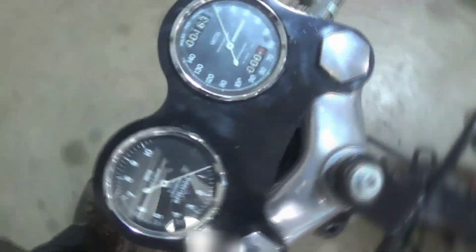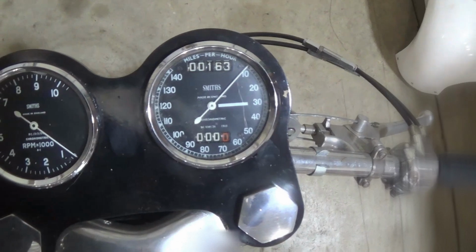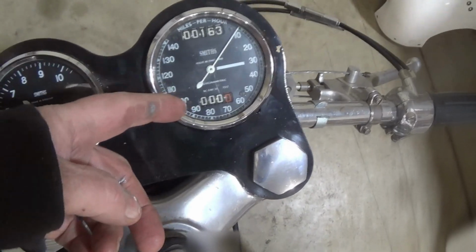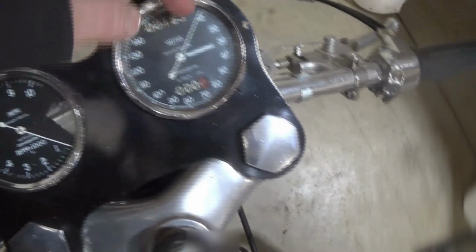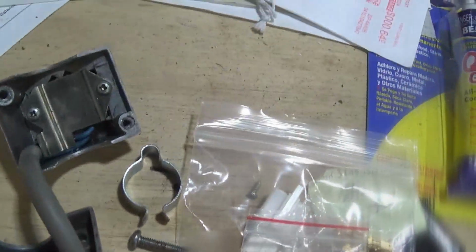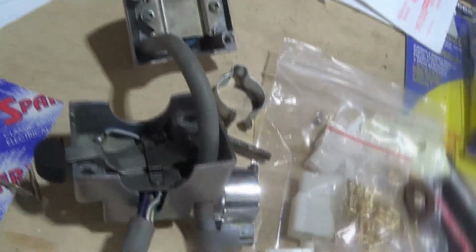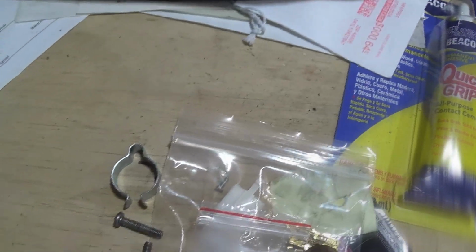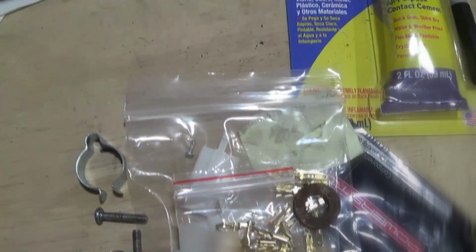I've been working on the tachometer, that's the tricky part. You have to reverse the direction, which means you had to change the silk screen, and you had to change the gear to get rid of the reverser gear. And there's actually a company in Iowa that does that, believe it or not. And then I'm struggling to get the right switches or the LEDs to do my left turn signal. I need auto flashing LEDs. And this has a left turn signal and a right turn signal and has a horn button. And I think that's it. Does it have anything else? Lights, yeah, lights and horn and left and right turn signal.